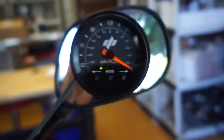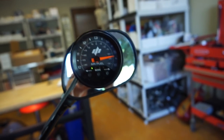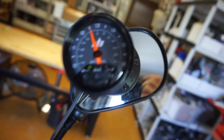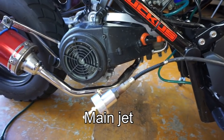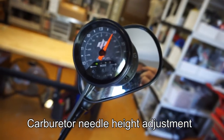So now we've got our gauge hooked up. We'll start it and make sure everything's working. We want to make sure it's completely warmed up before we do anything. It's nice and warmed up now — as you can see, it's idling at about 12.5 to 13. The best is 13.3. 14.7 is chemically ideal — that's what you find in your car. At high speed we're at 13.1, which is pretty good since best torque is at 13.3. But the mid-range goes all the way down to about 12, so we're having problems with our mid-range.